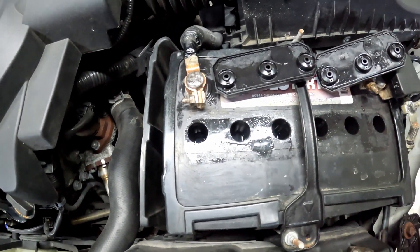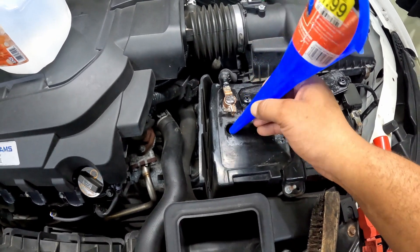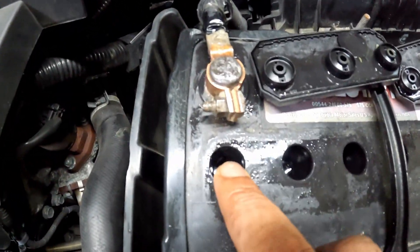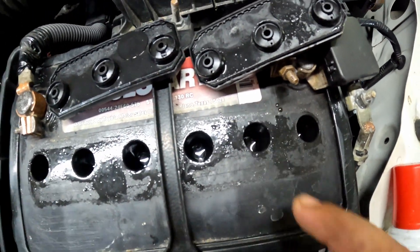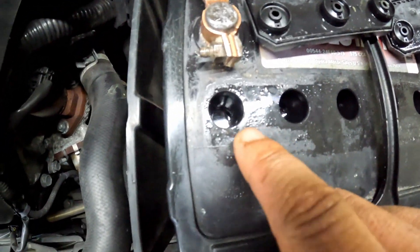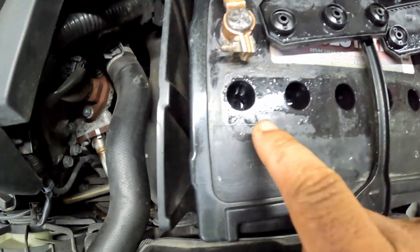You can add a little bit of distilled water to it. I found a funnel that fits perfectly inside these holes. I've already added some distilled water — I added some to this one, this one, this one, and I believe this one, so I had a couple that were low. If you look carefully in there you can see the plate, so you'll know how to gauge it.